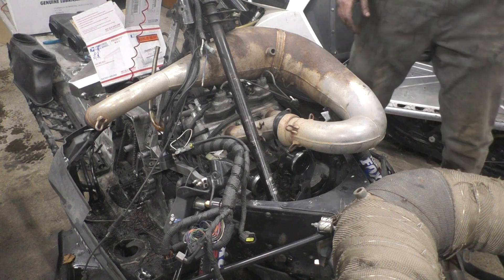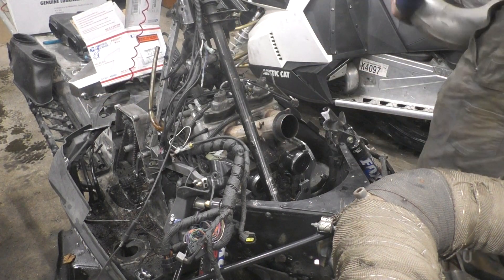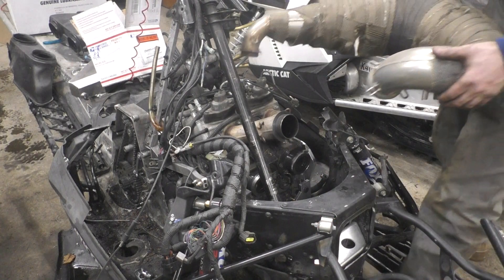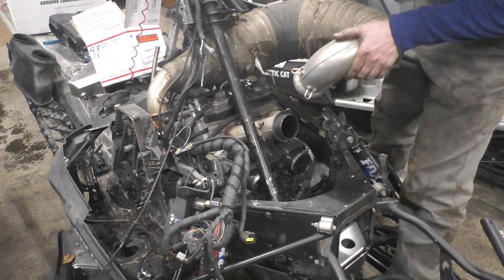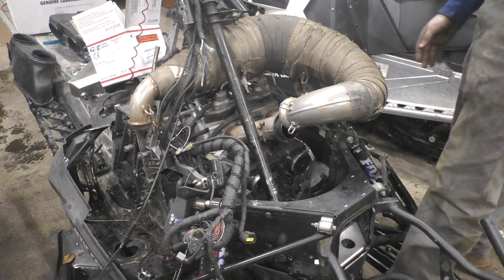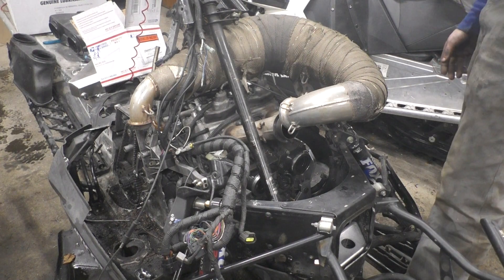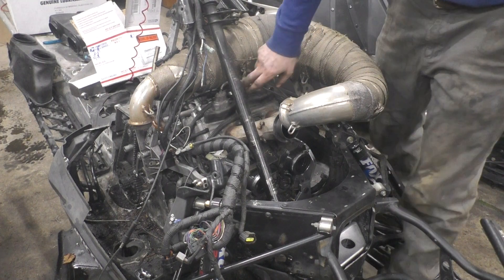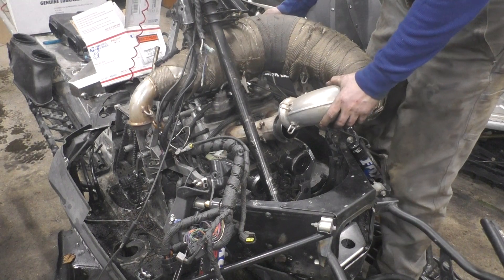Because it's got a sweep like that. This other pipe is from the 950 big bore — it's an SLP as well, but it was specifically made for the 950 big bore. It appears it may... I'm going to say it's too fat. It's sitting on top of the power valves and it's hitting the steering, and it's only getting fatter as I try to go in further. So that's not going to work.